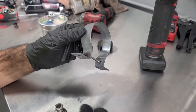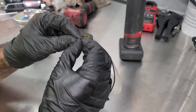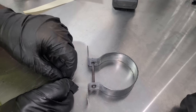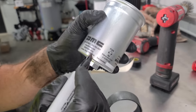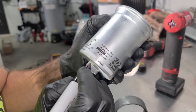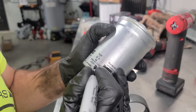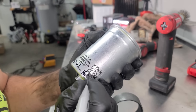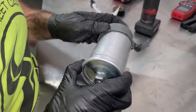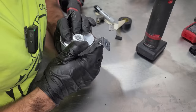I've cleaned up this bracket and this fitting, and we have a new piece of foam to install. I'm gonna trim this guy down just a tad, and there we go. Perfect. This is really cool. We can put the date that this was installed, replace every 2 years, 15,000 miles. What is today? I think it's 9/13/23, mileage 16,000, according to the cluster. I don't believe it. And now we can go ahead and slide this guy in. Just all the DeLorean mileage is off. I don't trust them. There we go.